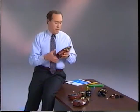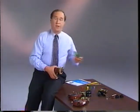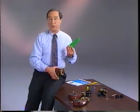Rockwell's simple mechanical ratchet-type adjuster does not utilize the slip clutches, which tend to wear out. Rockwell ASAs are available for steer, drive, and trailer axles. You can specify Rockwell ASAs for retrofits as well as original equipment. Except for installation templates, no special tools are needed for service or installation, so they're easy to install in the field.